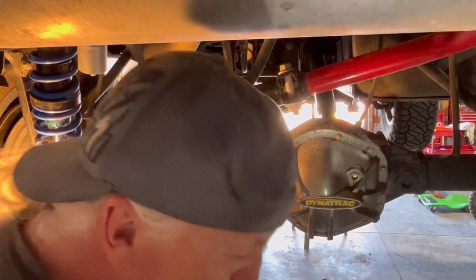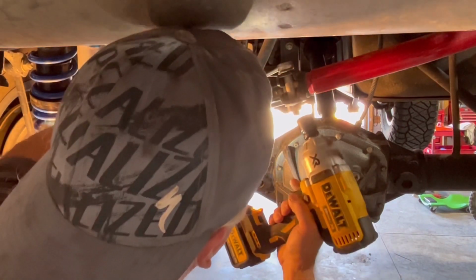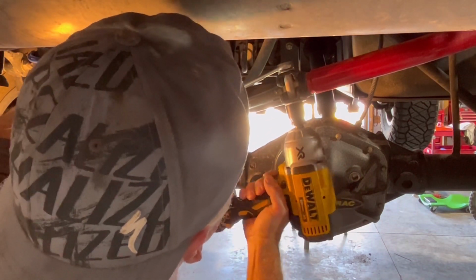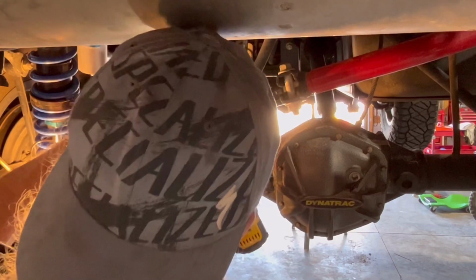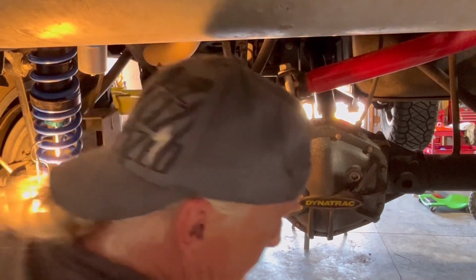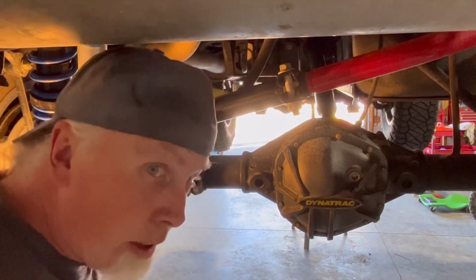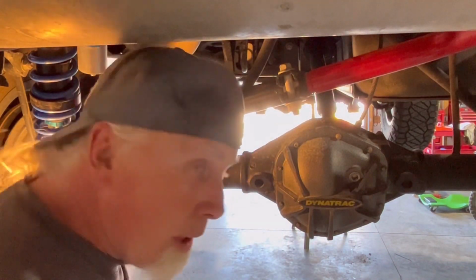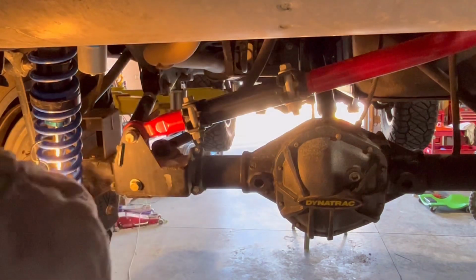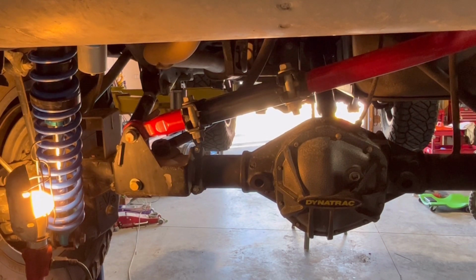And these, you gotta be careful with the torque. You don't want these things on high torque. You'll be over tightening stuff. It's a pretty strong gun. So I'm gonna cut the video, but I'm gonna go get a wrench and torque this, because torquing things with one of these guns, it really isn't a good idea. You can over tighten the crap out of stuff with these things. So I'll get another wrench and then I'll get this thing off the lift and see where we're at.